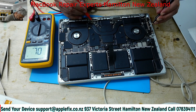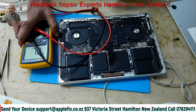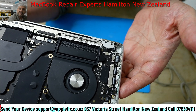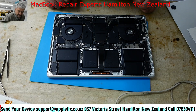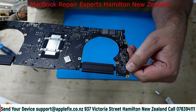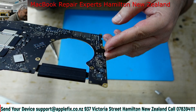Battery coil is okay, this is good, nothing here. The board all looks okay and it's clean - I could not see anything. This is difficult, especially since the board is new and I don't think there is any diagram for this model. The PD controller is on the other side, so I will remove the board. The board is out - we have got PD controller one, two, three, and four. One here. So clean - let's look under the microscope.